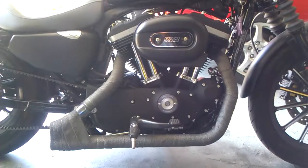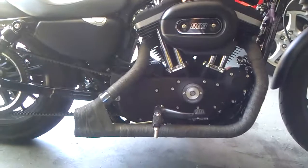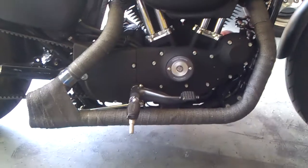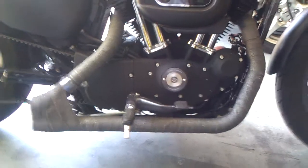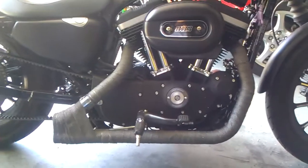This is my homemade stock exhaust. I just chopped off the mufflers and then added a 24 inch piece of exhaust pipe, welded it up real nice, tick welded it, grinded it smooth and then threw on a little bit of that exhaust tape. Looks pretty kick ass.